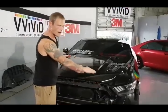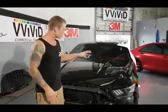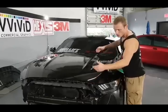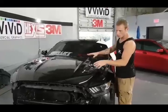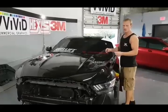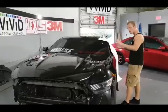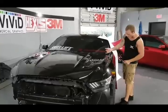We'll get to it right now. I already have the piece cut. This is the infamous hood that's larger than 60 inches in all directions. We could seam this, but I want to do this in one piece — and this will be very few in the world as a one-piece chrome hood wrap. A lot of installers use Avery at 48 inches or Hexis at 54 to 56 inches. This film comes 60 inches, which brings us about half an inch to three-quarters of an inch shy of this corner.